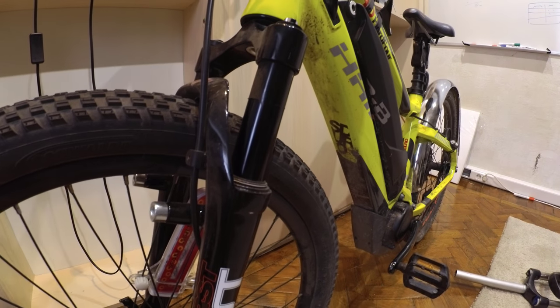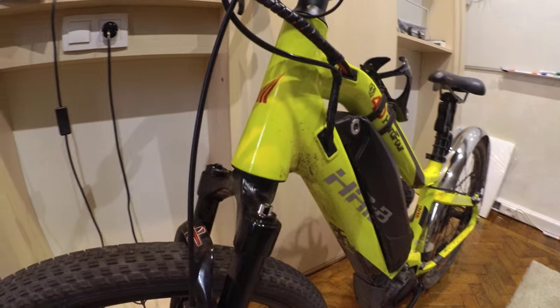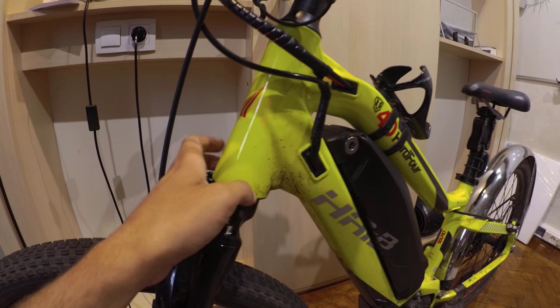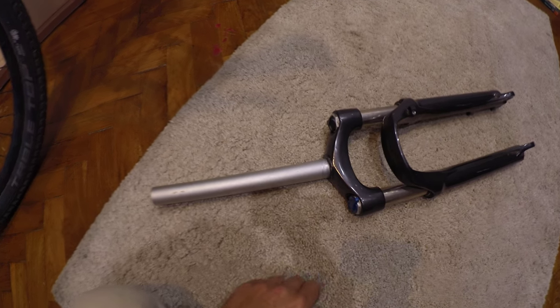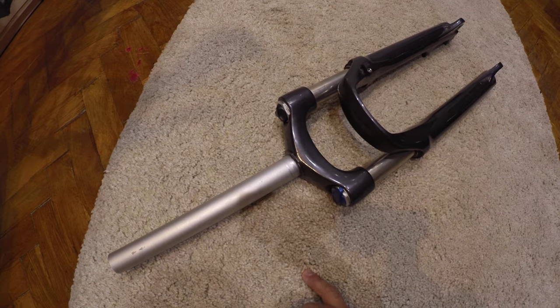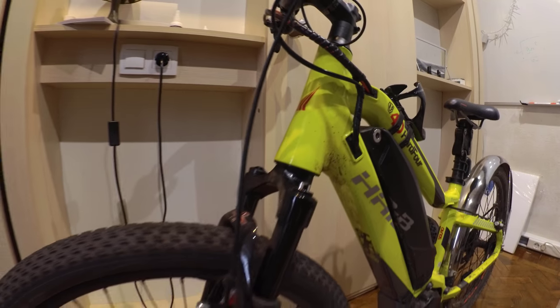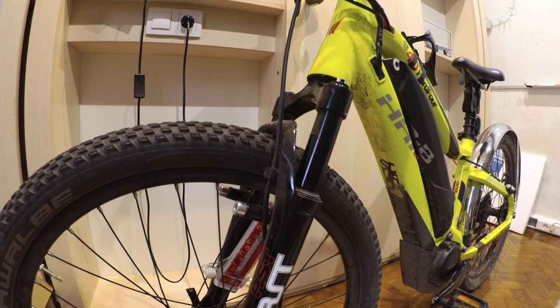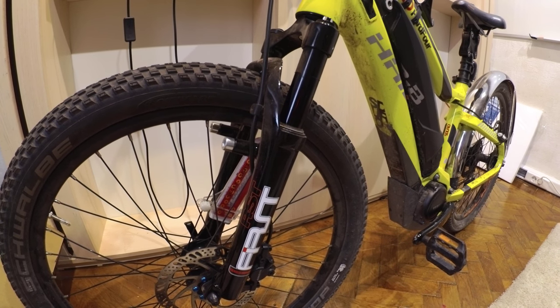When I was changing the forks, I found out a lot of interesting things about the HiBike because I had to take out the fork and put in the new one. First of all, the HiBike is in fact a frame designed for a tapered steerer. So you're probably wondering — you have two straight-steerer forks stuck into a tapered head tube, what's going on? Well, the Suntour fork had an adapter on it, adapting from a straight steerer to a conical tapered steerer. I transplanted that adapter from the old fork to the new one. Unfortunately I couldn't do this myself because — whether it was HiBike or Suntour — they used a steel adapter, a 1-1/8th straight steerer to tapered adapter, and I couldn't remove it, so I took it to the local bike store.